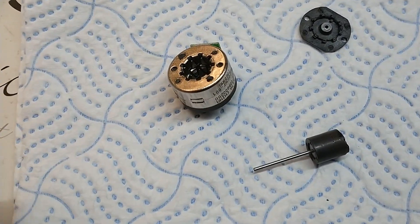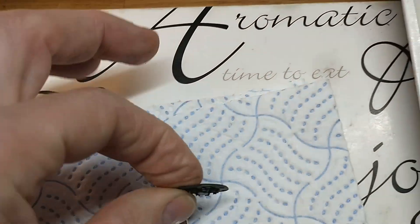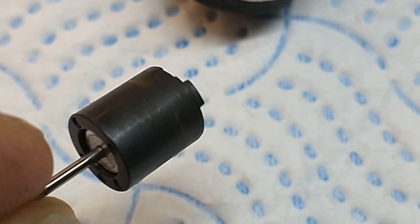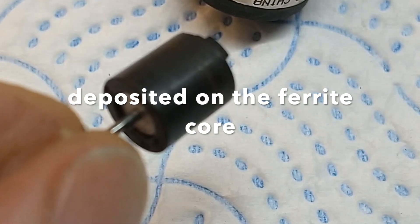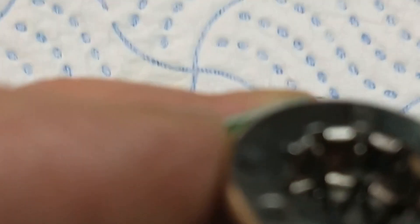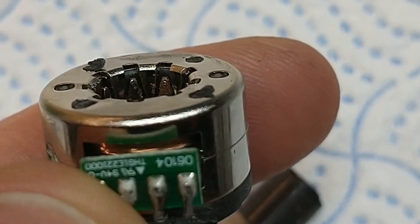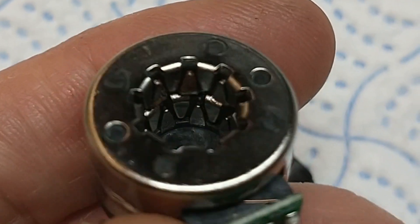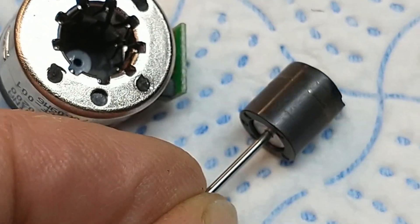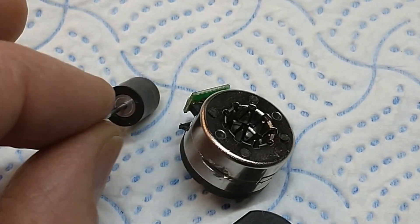I wondered what was actually wrong with these steppers causing them to jam up. It turns out you can pop the back plate off with a sharp knife, and inside there is a little bit of rust - you can just see it on the back edge there. Inside the shell where the windings are, there is actually a little bit of rust you can just see there. I guess that's the trouble with a vehicle that sits around for many weeks outdoors in West Wales where it rains and is very damp for much of the year, and the tolerance must be so tight that it doesn't take very much to bind them up. That was the problem with all my gauges on the van.